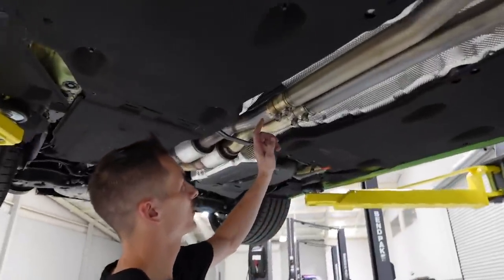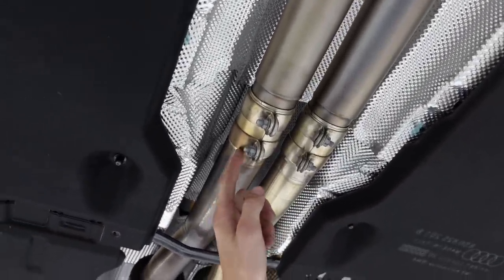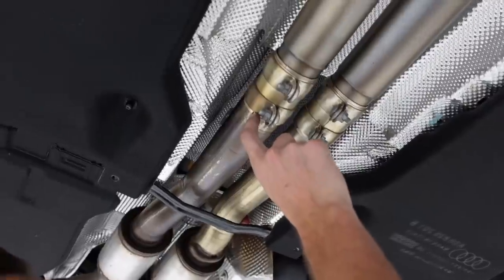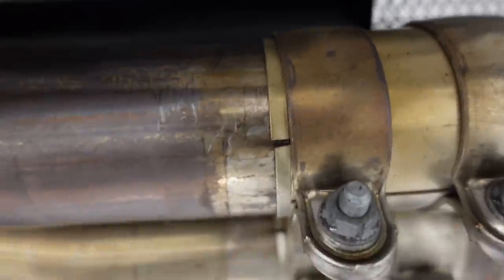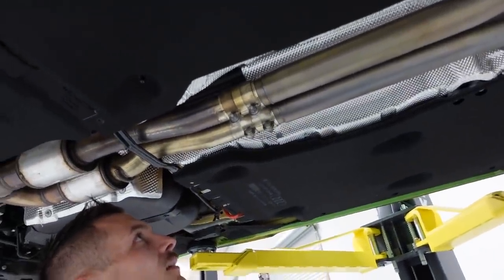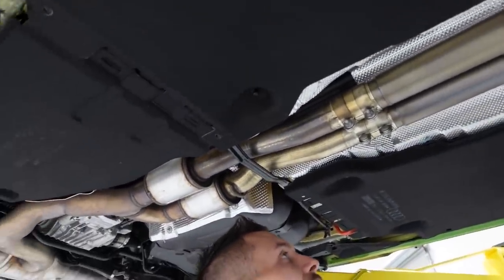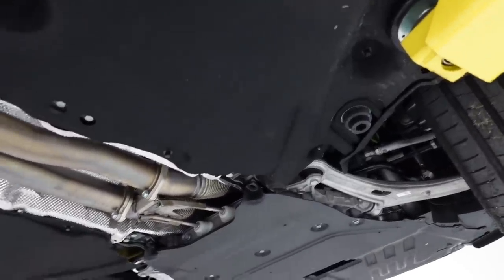You look for an exhaust leak on the creases and stuff for little black stuff. You can see how there's a little black line there. That's it. Ooh. I mean, I don't think that is your only one. Right there. But that is certainly an exhaust leak. Okay. I really do hope that's the only one because I really hope it's not the turbo clamp.